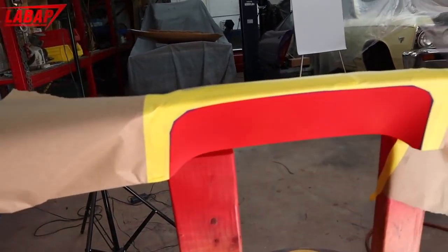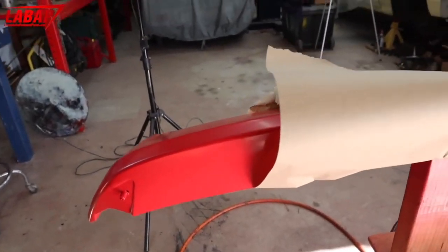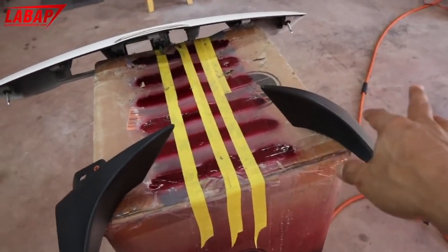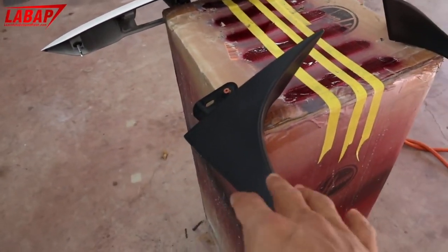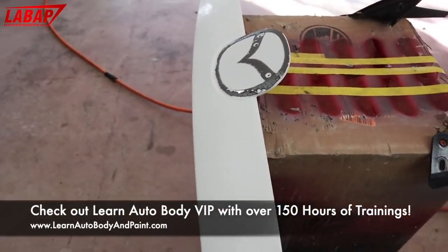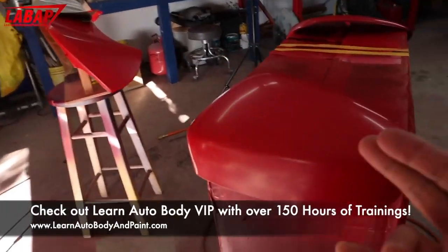All we're going to do is dust this area. If we do get overspray on this, it'll wipe right off with the tack rag. It's not a huge deal, okay? We're going to spray some Quik adhesion promoter on these bare plastic pieces, and then do our black base coat. This, we're just going to do black base coat, all right? Once this is all dry, then we're just going to candy our red.